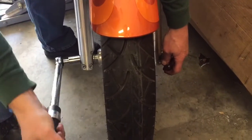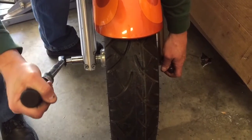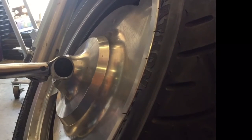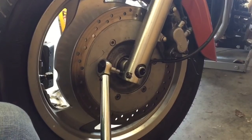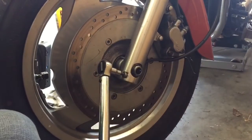So now I'm going to tighten up the axle nut — this gets tightened to 43 foot-pounds of torque, and I hold the screwdriver on the other side. Then I go down to my pinch bolts and tighten those to 16 foot-pounds of torque — I do both on the right side, then go around to the left side and tighten both bolts on the left side. And this is how you remove and replace the front wheel on a 2002 Honda Shadow. I'm HowToBob, thanks for watching.